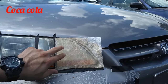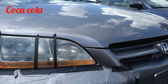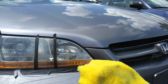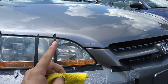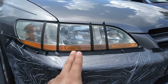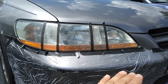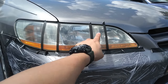After the second pass with the toothpaste I could see that it did clear a little bit better. So far it has been about 20 minutes since we were testing different hacks. With plain water you can see how the Coca-Cola did clean it, and we have some oxidation in the towel — Coca-Cola, not bad at all. For this headlight we used toothpaste, baking soda, and Coca-Cola. Either way all three methods work, and as you can see it's a lot more clear than the section we didn't clean.